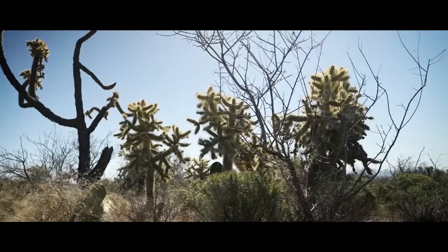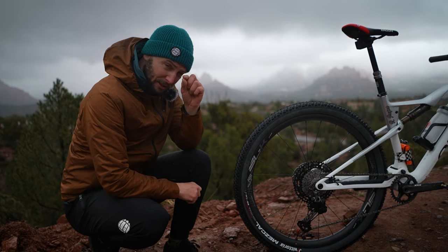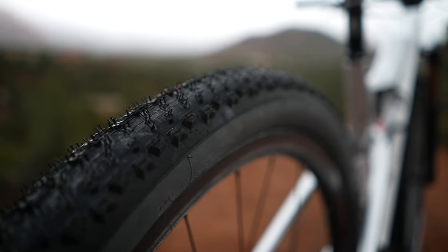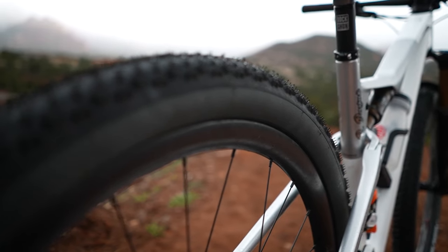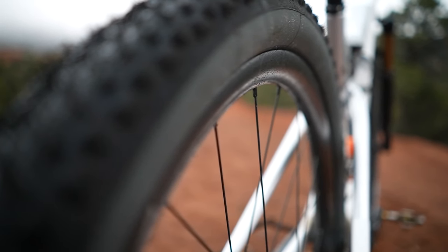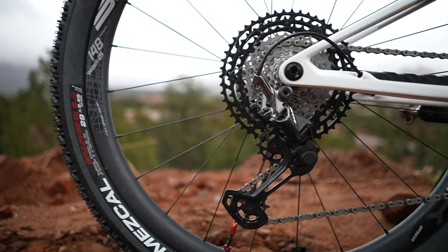On this particular bike setup, I'm doing a 24-hour race. Because of that — and there's a lot of cactus out here in Arizona — I've actually upgraded to the XC trail casing. It's an ever so slightly thicker casing to help on pinch punctures on the rocks and hopefully fend off those prickly cactuses. Similar width, hard pack out here, it's a bit loose but generally very hard pack and a long course. We've got the Mezcal tires front and rear, laced up to carbon wheels.